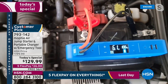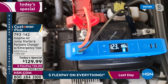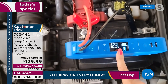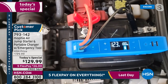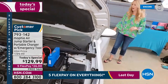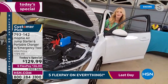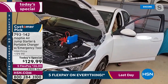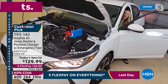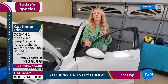So I'm gonna tap the button. The green blinking light means thinking, and that's going through a series of safety tests that it's processing through. Once it's a solid green light, look what's happened. You're at 12.3 volts. So anything less than 12 volts, that's gonna be a dead car battery, right? Now that I see the 12 on there and that solid green light, I know what's gonna happen. I'm gonna be able to get into this car and start it.